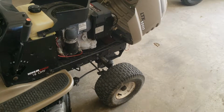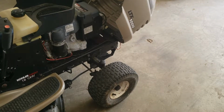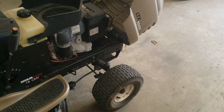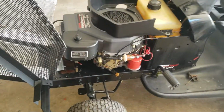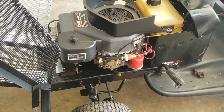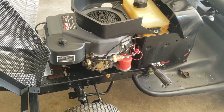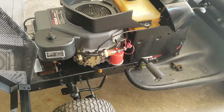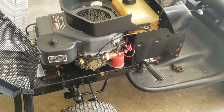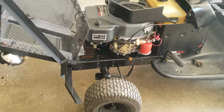I know this one has a few issues with its carburetor, so what I'm hoping to do is take the backfire prevention solenoid from this one's carburetor and put it onto this one's carburetor that's been cut. This one here, the actual carburetor itself is hopefully in good shape, so I can just put it back together enough to make it work, but it'll still have the similar issues. And then when I get my new carburetors in, this one here will just get a brand new carburetor.